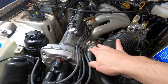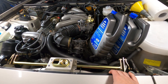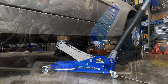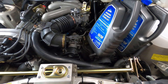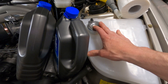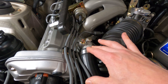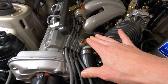Before we begin pressurization and venting at the water neck, it helps to have this point in the engine elevated even higher off the ground. So if you can get the front of the car raised 12 inches or more, it helps work the air up and out of the system. To pressurize the system, you can use a coolant pressure tester or the gravity fill method. If you have the pressure tester, just attach it to the tank and pressurize the system not to exceed 10 psi, and continue to vent at the water neck until all the air has escaped and a steady stream is flowing from the top. Close it down and you're good to go.